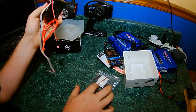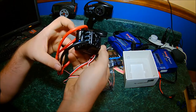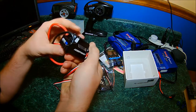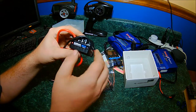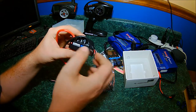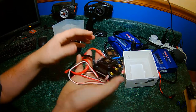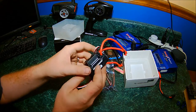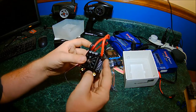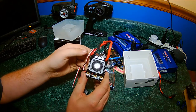That way you don't have to go into your receiver box to unplug this to put it in the program card. That's another cool feature — it makes it a lot easier to program on the fly and keep on bashing. It's rated 3S to 6S LiPo, 6 amp BEC, and it's 150 amps total. Very cool. I cannot wait to get this installed into my eRevo 2.0. Once I do, I will give you all a running review of this ESC. Thanks for watching guys and I will see you all next time.